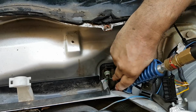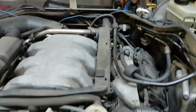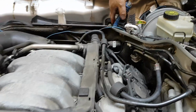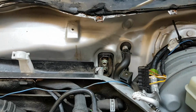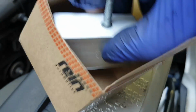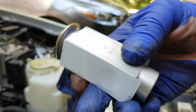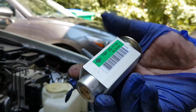And then if you have an air gun, just press some air into the evaporator. This is the point where, if you have the right chemicals in the machine, you can wash the evaporator. Some people do that. If yours is dirty, maybe you should, but I didn't. Compare the new expansion valve to the old unit. Make sure you have the right part, and I'll have the part in the description for the W210.